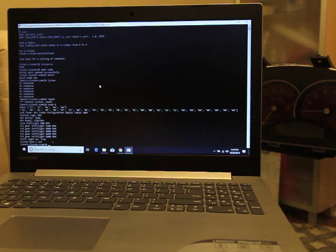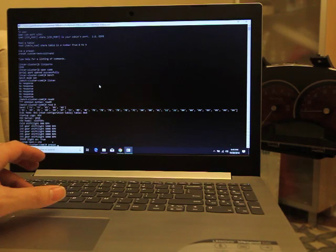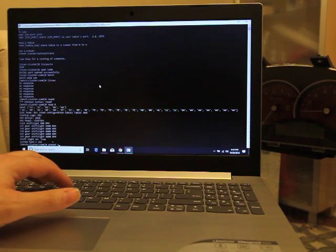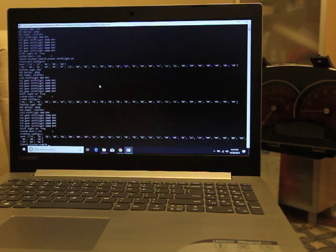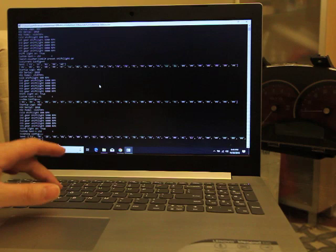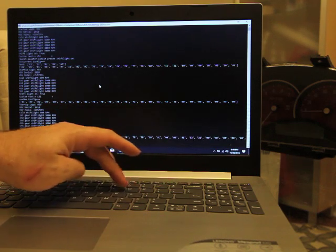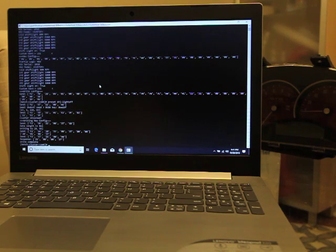To activate the shift light, I've printed off everything from the website. All the shortcuts are there, which I recommend. To turn the shift light on, type 'preset shift-light-on'. I've already turned it on and it went through the procedure again. You can also type 'preset shift-light-off' to turn it off if you want. You can also type 'preset DRL-light-off' to turn off the daytime running lamp indicator in the dash — some people didn't like seeing that.